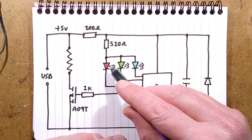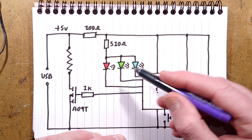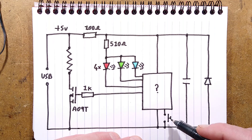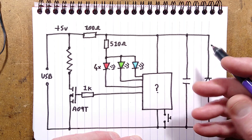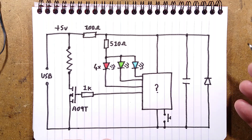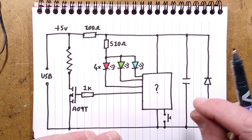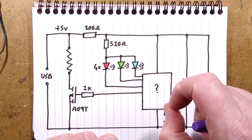The LEDs are switched — only one colour is lit at a time so they can use just one resistor, and they're all in parallel. The push button pulls one of the pins that is normally held high internally by a weak pull-up; it's pulled low by pressing the button. You click the button to step through the modes — it's all just timing in the microcontroller, stepping through LED colours and cycling the MOSFET on and off to vary the heat.